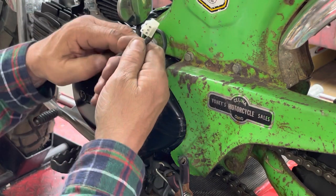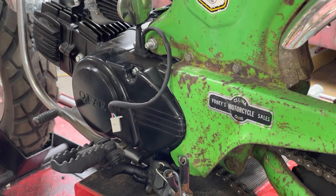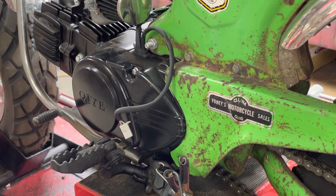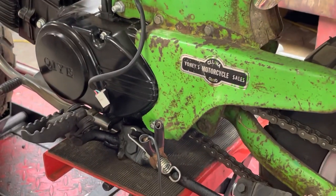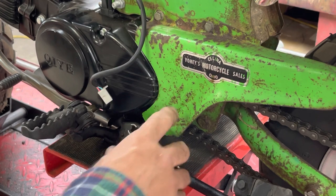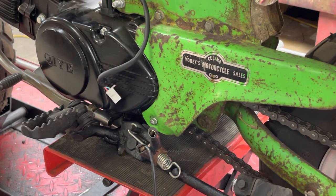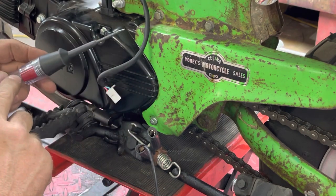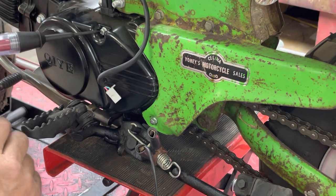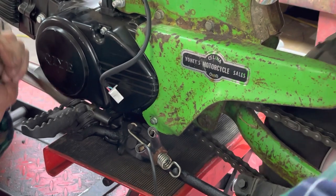The subscriber who contacted me is having a hard time figuring out which wires go to which gear. So what I've done is set up my 12-volt battery charger as a power supply, grounded it to the bike on the kickstand spring, and hooked a test light — you can pick these up at any auto parts store — to the positive on the battery charger. Now whenever the pointer touches ground it should light up, completing the loop. The bike is all-down, so it's in neutral.